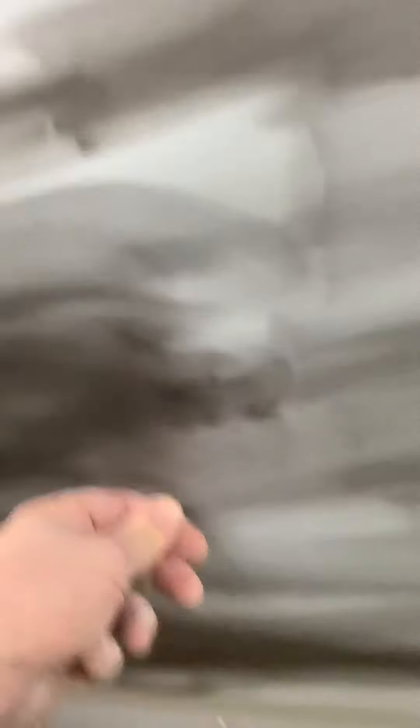Believe it or not, it's going to take forever, but it will be so much straighter and look so nice. You have to sand it anyway, so you might as well make it look nice. The same goes for some of the door panels — you get into the center of a door, you don't want to be pushing to where it's flexing. Just lightly block that. That's just the way body panels are, especially if you get a cheap panel. The passenger side fender here is an aftermarket fender — I won't even touch it.